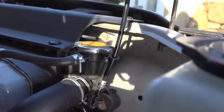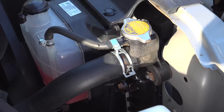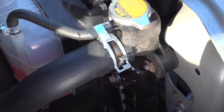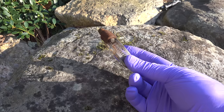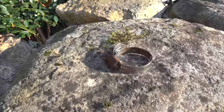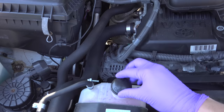If you're skeptical thinking these clamps couldn't be strong enough — even when I beat on this with the end of my channel locks, they don't move at all. Nothing's going to happen until you squeeze both ends of that clamp together. And as tight as it is, the clamp can still expand and contract according to the temperature so you'll never have a leak in the future. I know that hose clamps aren't exciting, but if you've got a leak in your vehicle and can't figure it out, it's well worth checking your clamps to make sure you've got the right kind and you're getting a tight seal.